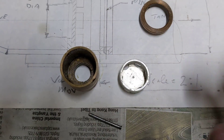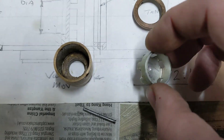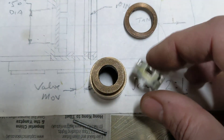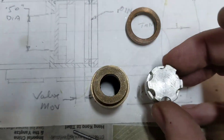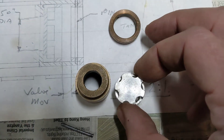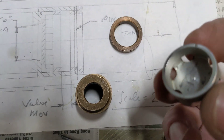You can see the thin aluminium part in there and the holes I was talking about. If I take the top hat off, you can see inside the actual part itself — it moves forwards and backwards as the air flows in and out. There it is; that's the piece that moves backwards and forwards. That's the housing it sits in. When it is all the way at this end, no air can pass in that direction. But as it's off the seat, air can come around the outside through those holes and up in this direction.